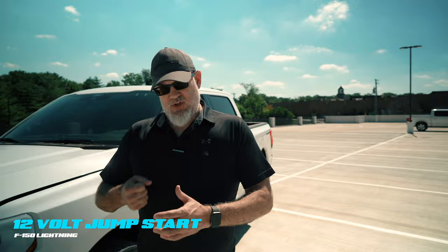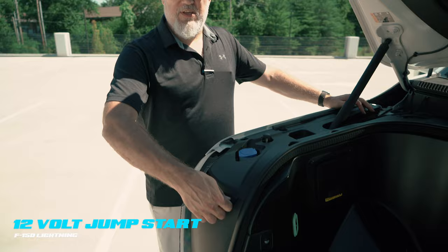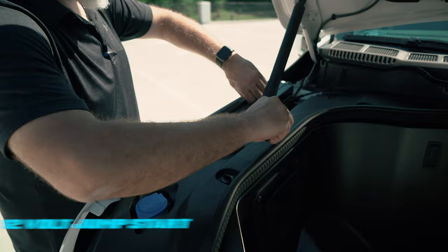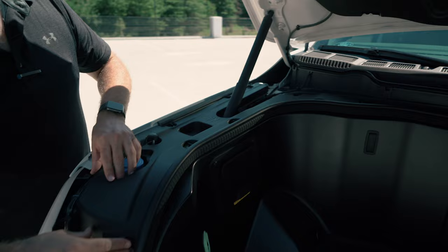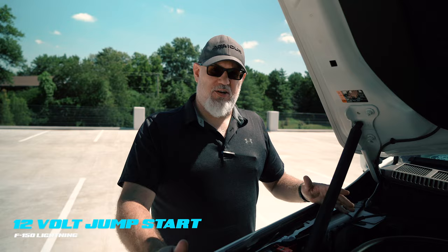We want to make sure we're very delicate in pulling that up. When you pull that release, give it a good tug so the front trunk panel deploys correctly. Pull it up real slow. We need to get this panel out — they've made it easy with a series of twist-lock fasteners. Just a quarter turn counterclockwise to disengage all of them. Get all of them and systematically take each one loose. The panel comes out with relative ease. We have the positive and negative jump posts right here on the passenger side fender apron of the F-150 Lightning.